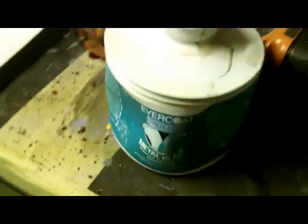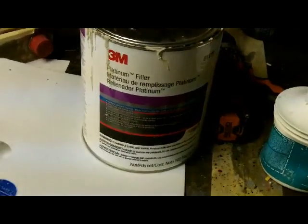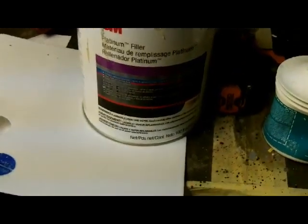That's a big two-stage air compressor, something that's going to put out some cubic feet per minute. That's definitely something to have. But, I mean, you need your fillers. That's a glazing putty to fill in sand scratches and pinholes. After you've sanded a filler like this, which is just a lightweight stain-resistant body filler, that'd be probably your first step.